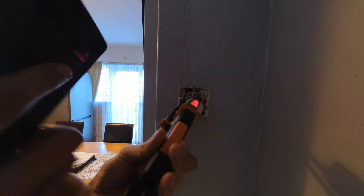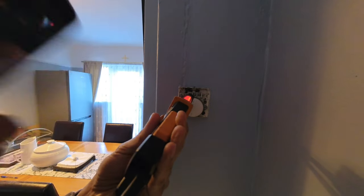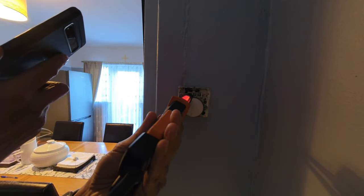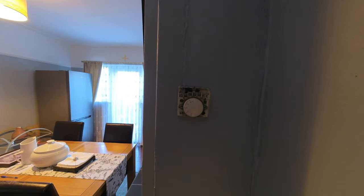So we've got 230 on neutral. That's turned up. Do we have 230? Yep, we've got 230 on the switch as well. So I reckon it's going to be a dodgy synchro motor. Let's go and check the three port.